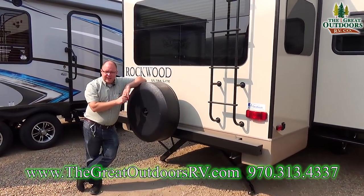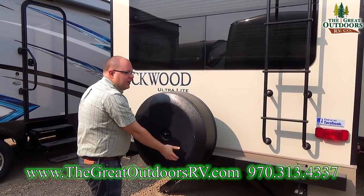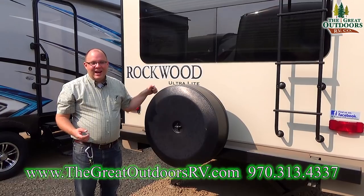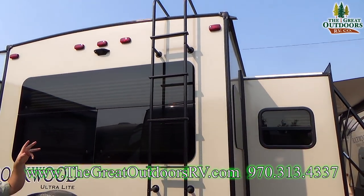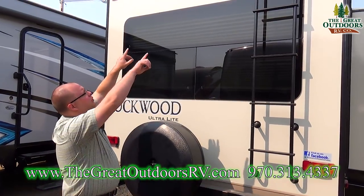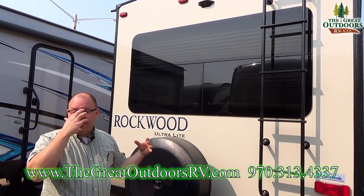At the back of the 2906, this hard plastic tire cover is much better than soft fabric tire covers — fabric ones begin to crack along the top from sun exposure over time, while this one won't break unless you physically beat it up. There's a ladder to gain access to the roof for maintenance — you really only need to go up there to clean and condition the roof, which extends its life well beyond the 12-year warranty. The roof also has a radius curve to it — that helps shed water off and prevents leaks. And there are two black gutter spigots on each corner to shoot water away from the sides so you don't get black streaks down the coach.